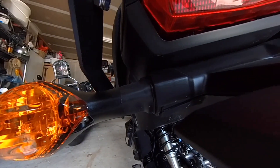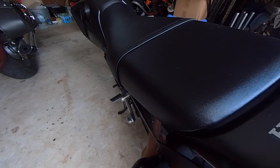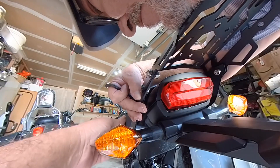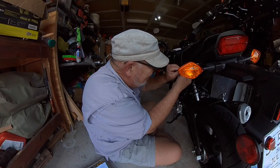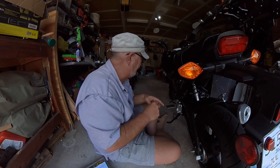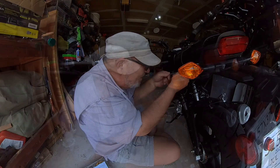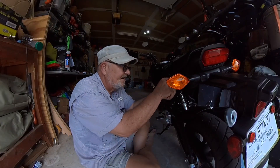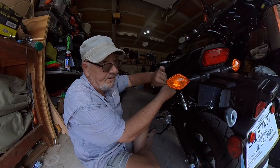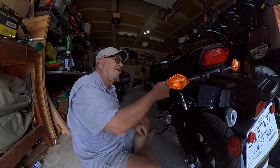There's a recess right here and that's what these sleeves fit into, like that. This one's going in now. I think what happened is paint ran into these holes, maybe because of how the bike is leaned. I need to get that paint out of there. I basically got it in there and started going back and forth like that, put some WD-40 on it — and that's my wife holding it — and finally it's going in.